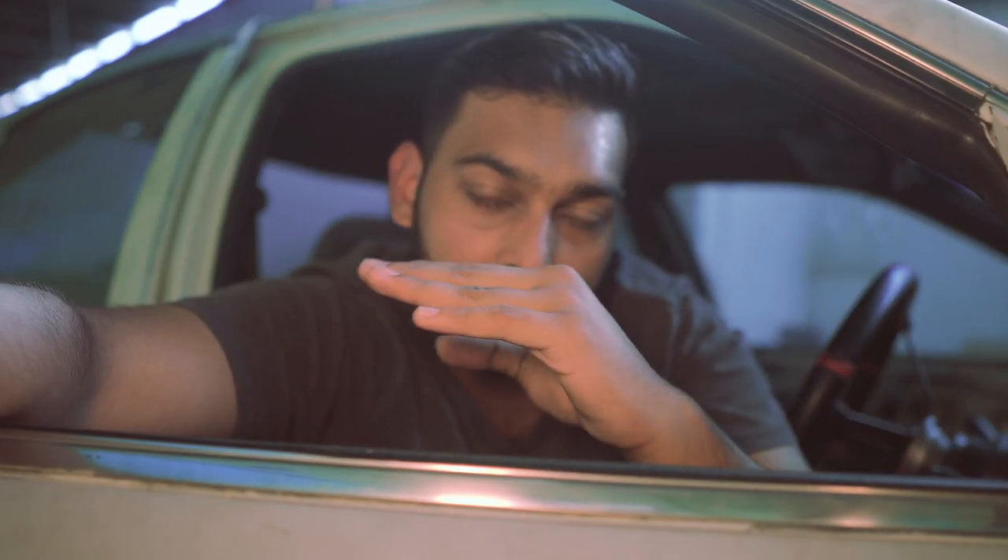So it's a whole loop-de-loop thing and the paint is what's holding me back right now. As you saw, the engine is lopsided and that's because one of the mounts broke. I have to go and build a bracket and put a different mount on it because I have a big box. There are two different types of gearbox — a small box and a big box — and I have the big box, so the original V40 mount doesn't work. It works but it has the whole gearbox and engine tilted, which isn't really good.